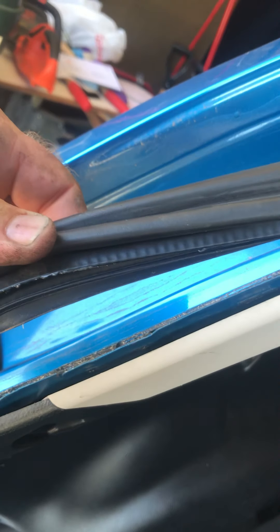there's a little nipple that sticks out so the plastic still hangs on to it, so you've got to kind of push the plastic out and away, then this will fold out enough to get it out. I highly recommend pulling this rubber trim out of the way first, and then you can see there are push pins in there — you can see where to gently pry to get your push pins. The rubber sets back in real easy.